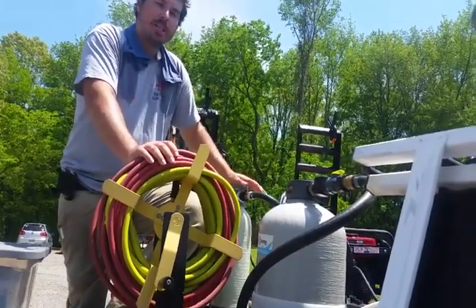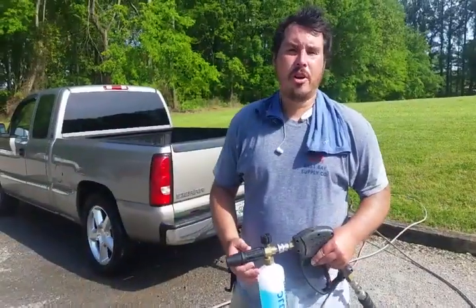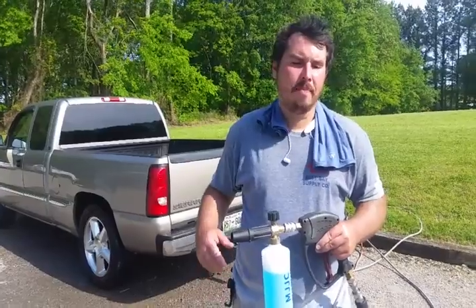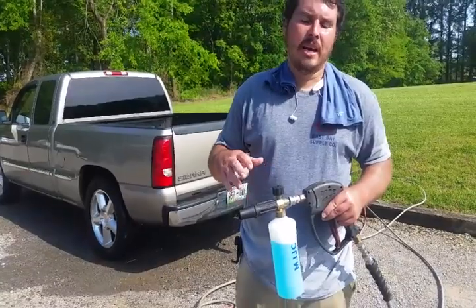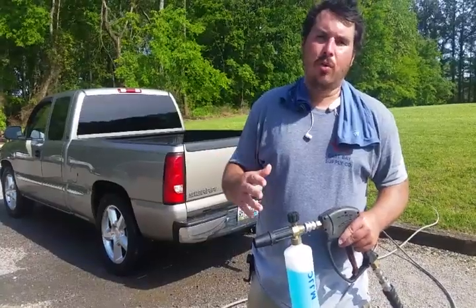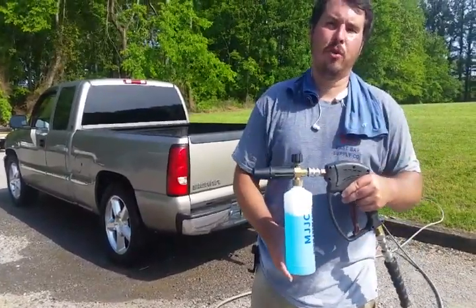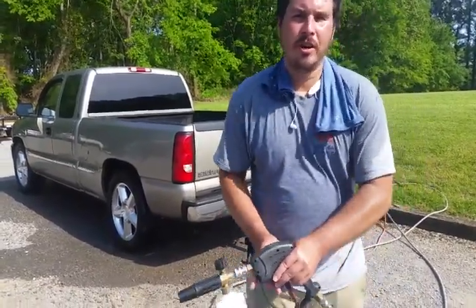So I'm going to show this thing in action, and that'll be the next part of the video. I'll show you all the type of foam that you can get with the DI tank. I should have shown what it would look like with the regular water first. I do have another video on that, but just trust me, my water is about 130 TDS, and the foam is kind of runny. Now I've got 2 ounces of Chemical Guys Foam Works in about 700 milliliters of water, so three-quarters of the way full, only 2 ounces, and this is what you can get.